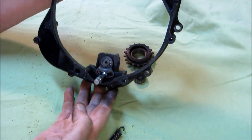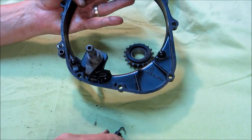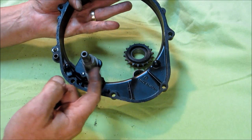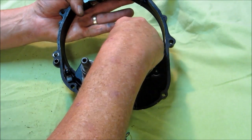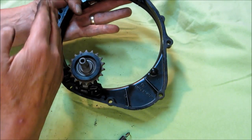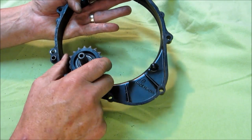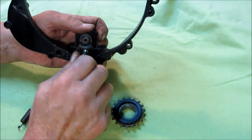I've got the mechanism assembled into the case, and this is about how it sits on the engine. On the back side, you can see that the lever here, to which the spring is supposed to be attached, moves the eccentric in and out. This side of the eccentric is moving in this direction. With the idler gear mounted on that and the chain over it, as we move this lever back and forth, we're adding tension to this run of the chain. The spring will apply the proper amount of tension to get the chain good and tight, and once that's done, we tighten the bolt on the other side. So what the doohickey really does is it holds the adjustment.